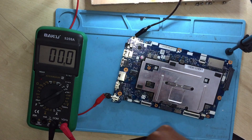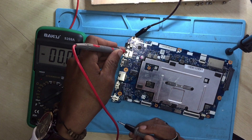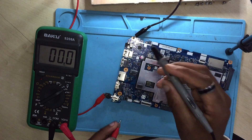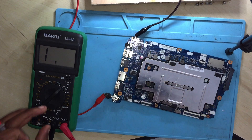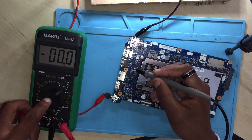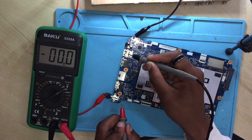Let's go ahead and check. We need to make sure that you do have 19 volts flowing into the motherboard. Check starting from your charger to see how many volts you are getting. Connect one probe to ground and check — if it gives you an overrange reading, it means the volts are more than 20, so shift your range to 200 volts and check again. You should be getting 19.2 volts from the charger. Now let's check from the charging pin.